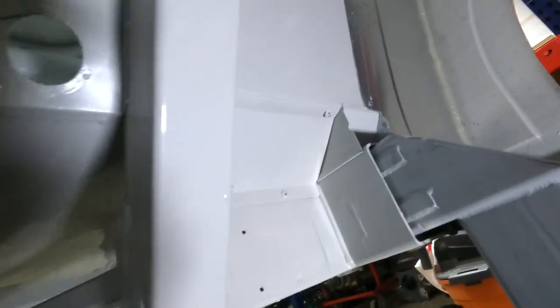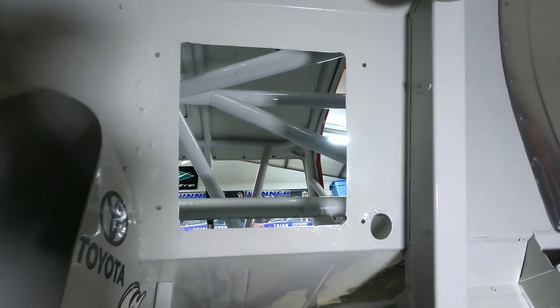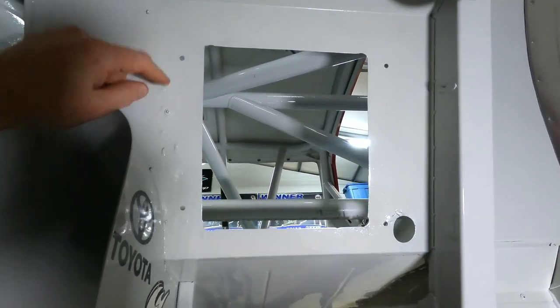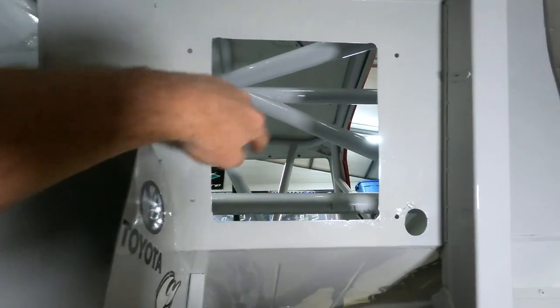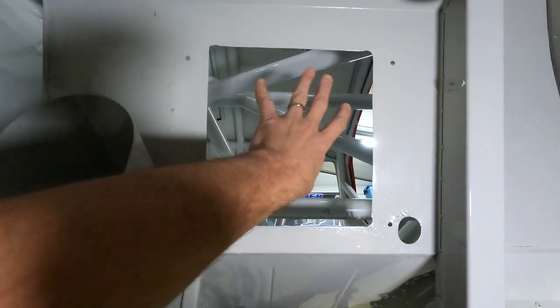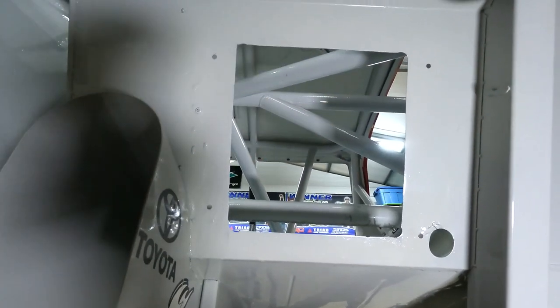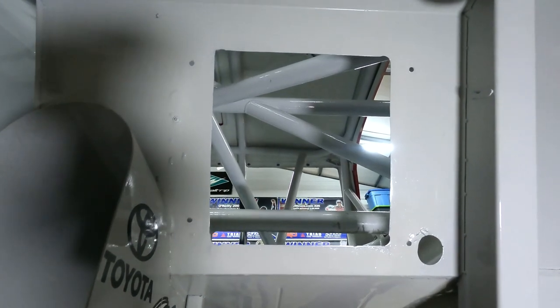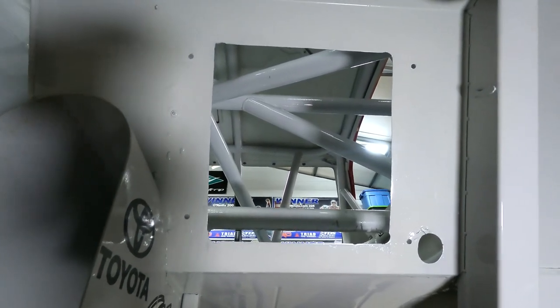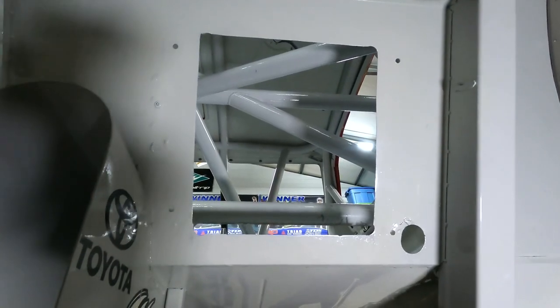And then here is the right rear. I've also touched up the entire area around the rear gear cooler since we've opened it up and enlarged it. I've also drilled the mounting holes for the cooler. Up next, we're going to trim the carbon duct that fits on the interior portion. I'm going to take the gear cooler itself, install some floating nut plates on it so that I can bolt it through the interior. And we'll put some high temp weather strip on it and get it installed.